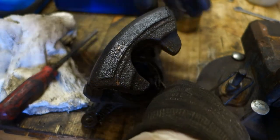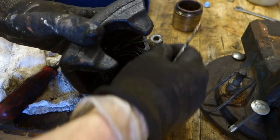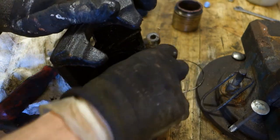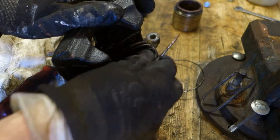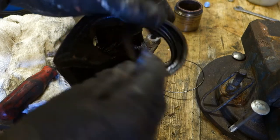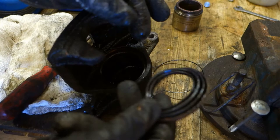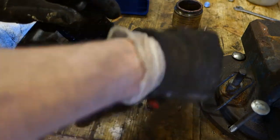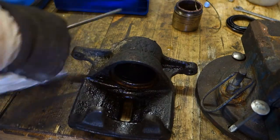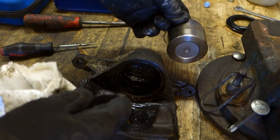Okay, now it opens. This is this metallic pin, and this is like a locking pin, and then this rubber boot we can take out, and maybe reuse it if it is fine. But actually I recommend that we purchase a new rubber boot. And here we can then look at this inside area. And it must be also as shiny as this piston.